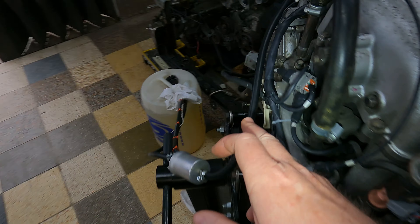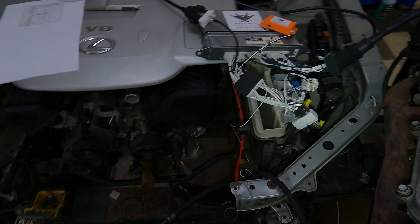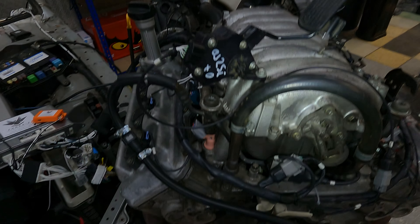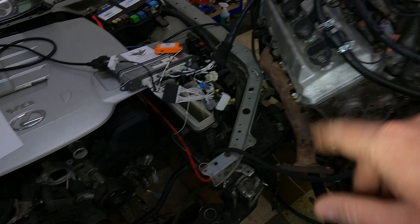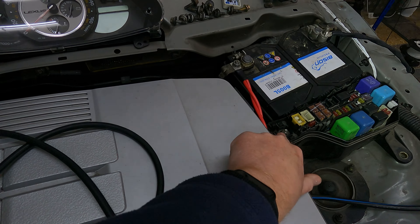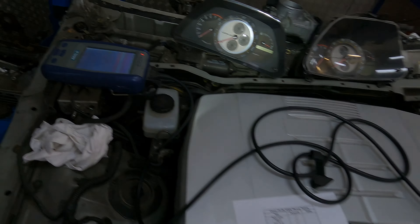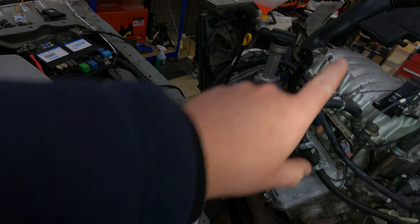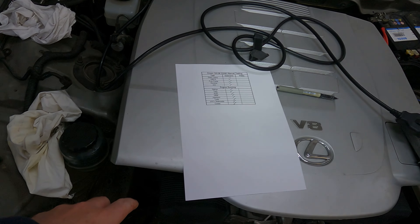All that you have to add to the system is obviously your starter wire - that's all separate and you'll get it in your box with your harness. And then your alternator - you've got your main alternator cable over there. Mine's actually running underneath and it bolts right here at the fuse box. Obviously yours is left-hand drive, so yours is going to be over on this side - you just need to make that wire reach straight up to there.